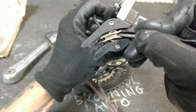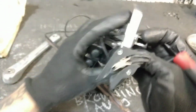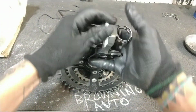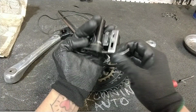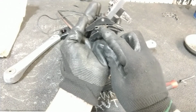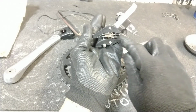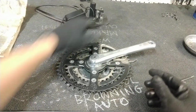So, this little ramp, what it's doing is it is mounted using this clamp to the seat tube of your bicycle. There's a chain guard, so your chain won't come off here. And this chute, whether the corresponding piece in the crankset is channeled up or down, will cause an upshift or a downshift.